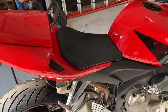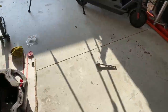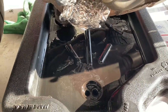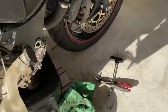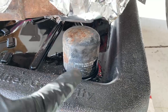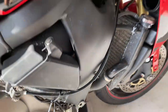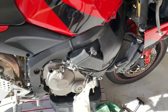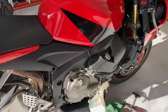I've got the bike tilted forward — I'm trying to drain this thing completely dry. As you can see from the oil, it's pretty dark. I wouldn't be surprised if this is the original oil from 2005. This thing only has less than 8,000 miles on it. I've seen a lot of original equipment — I believe this is an original factory oil filter as well, so this all supports the mileage being accurate. It will be an actual mileage title. The good is that everything is original; the bad is I don't think they ever changed anything or did any maintenance on it.